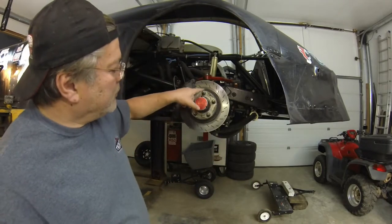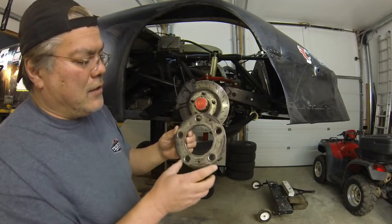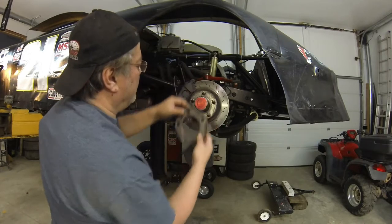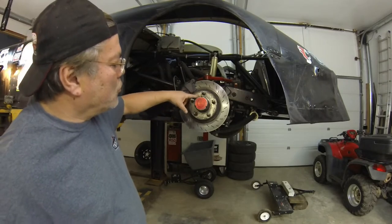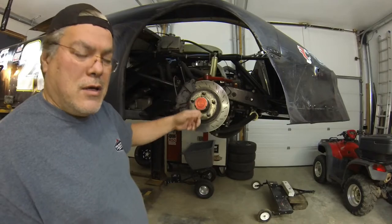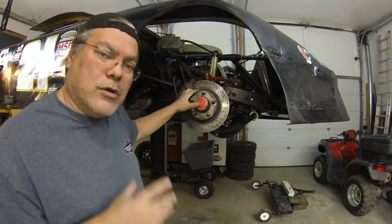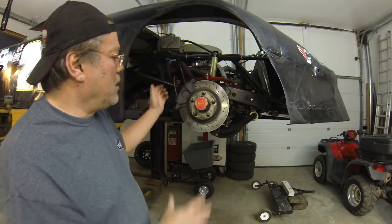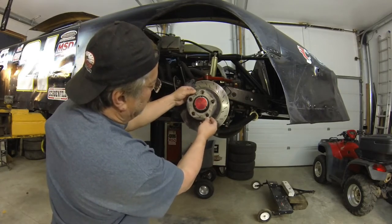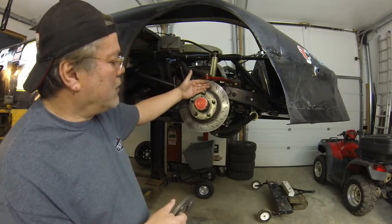The hub itself is simply a flat surface. Here's something else that will blow your mind: this is a spacer, and it is not machined to a specific requirement. It is capable of being put on backwards or forwards — it doesn't matter. If you didn't have to have it at all, you'd still just use a flat surface. Nothing more — no shoulders, nothing else is holding that wheel rim concentric relative to the center of the spindle. If the holes that hold the wheel are not centered, the wheel is going to be out of round and will vibrate both laterally and horizontally. You've got to center the nuts and torque them correctly.